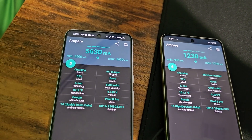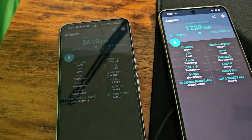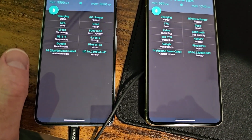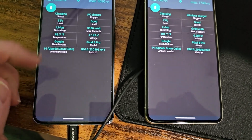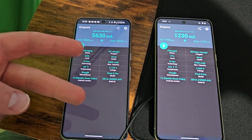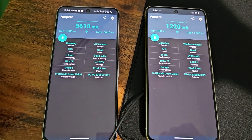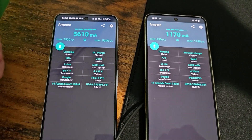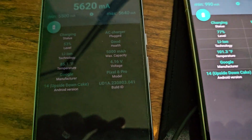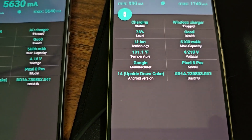That's one of the ways OnePlus can charge their phones from 0 to 100 in about 30 minutes — they just throw a ton of juice at it. They also have two battery cells in there. If you have a full 5,000 milliamp battery and you basically cut it in half, you run those two 2,500 milliamp batteries in parallel. You're charging those two smaller batteries at the same time, but it still equals 5,000 milliamps total. That's how they can charge them super fast. This Pixel only has one cell, but look how fast it's charging — and it's not overheating.